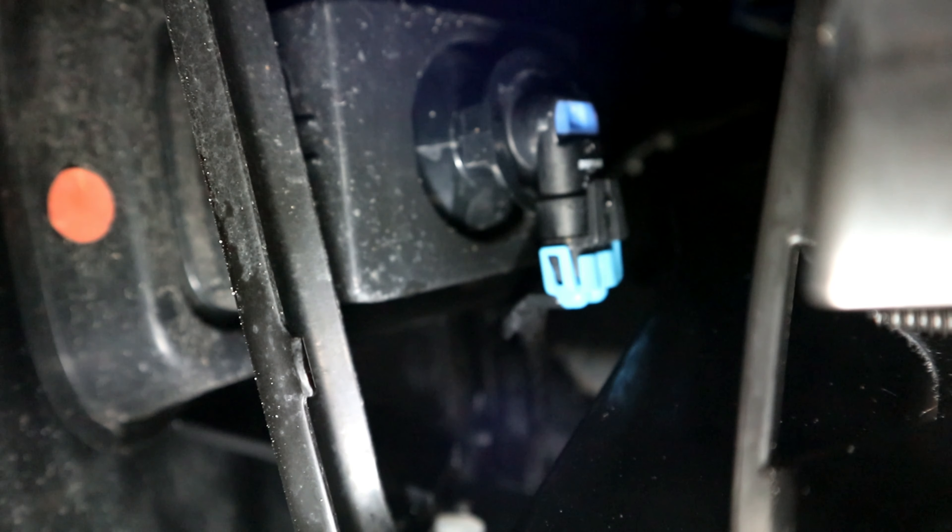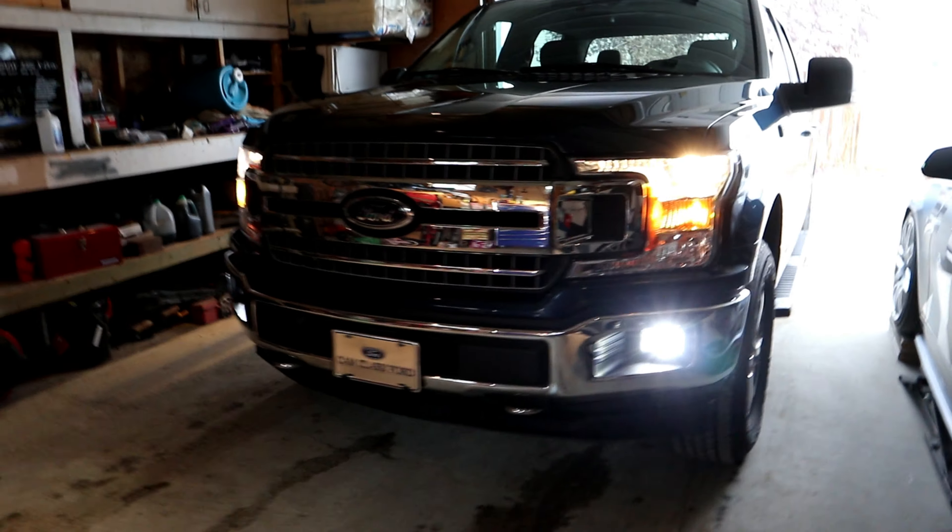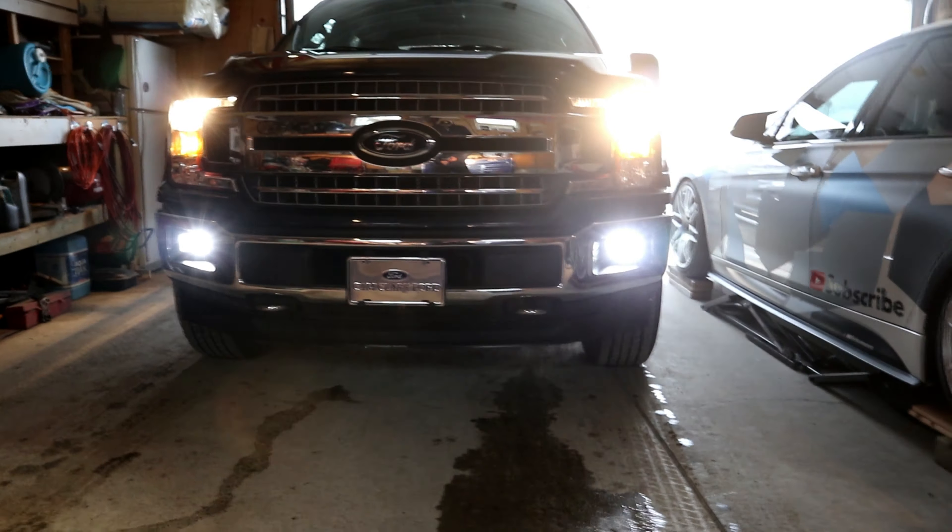This is before. Hopefully that's translating okay on the camera but we're going to get rid of this yellowness. If you want to know how to change the fog light bulbs they are quite simple — just in through this fender liner you can see the fog light bulbs are right there. Just unclip them and then twist them out and pull out, it's that simple. Nice white LED light. Yellow, white — drop a comment below, what do you guys prefer? Do you like the white LED or do you like the original yellow halogen? I'm pretty sure I already know the answer but let me know in the comments below.